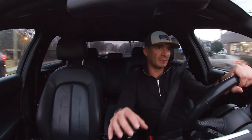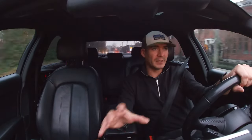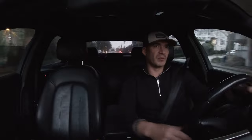It's an enclosed system. It's a system that I delete on diesels and just vent to the atmosphere. Most people in gas, like with the LS stuff, everybody's running catch cans, and you can get away from it. I don't know if they make baffled valve covers for these A6s, but they do in LS. I'm more of an LS guy, so baffled valve covers would make a huge difference as well.